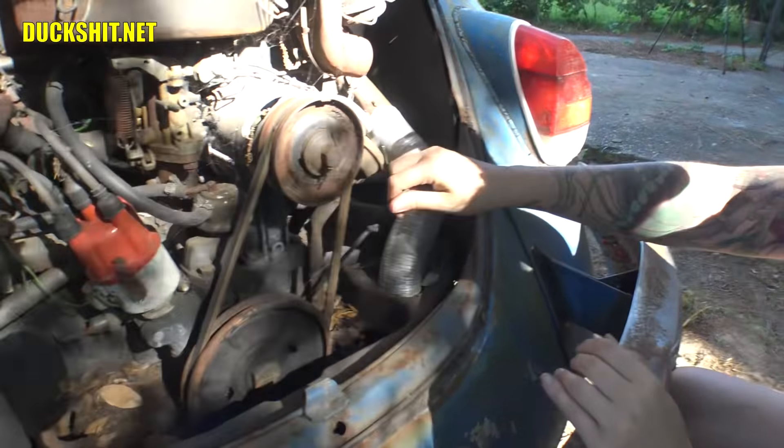So in summary, the car is in some pretty rough shape, but it is very repairable. Everything that appears to be rusted is just the stuff on the bottom sections, which is pretty normal on these things. If you're going to find an old Beetle that's been sitting for a while, you're usually going to find a hole around the battery area, and probably over on the driver's side too — there are going to be little heater channel repairs. But overall, this car in some ways is better than some of the others. It just looks like it's more complete. Everything's there, all the VIN numbers are on it, the numbers match the title, the title is clear, and the engine turns over with a little end play. So this one would be a good candidate to buy and probably restore. Depending upon your ability or your budget, you may decide one way or the other — and again that affects your final price. I'm not going to tell you what I would offer on this because it might be different in your market and you might have a different budget. If you're not sure what it's worth, look up on the Samba and check out other cars that are like this one, then cut the price in half because everything up there is way overinflated.